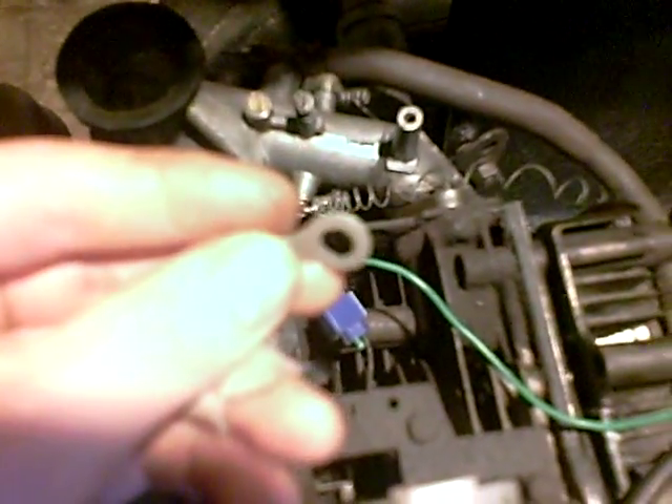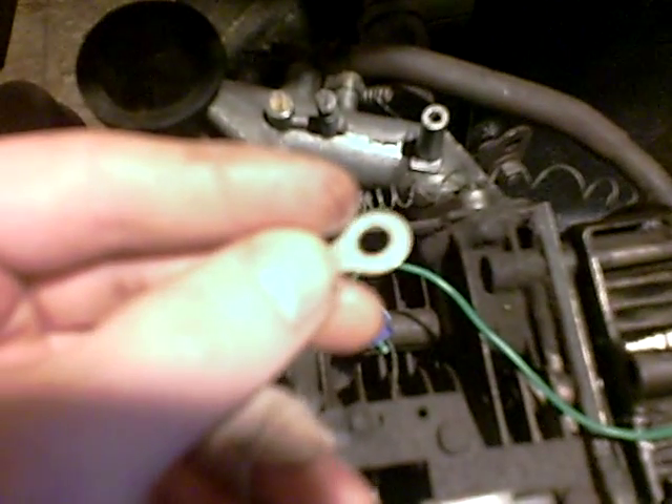I just put a little bolt in this thing — just a tight end of the bolt. I didn't really need it, but I put it there anyway just in case. And the gas pedal — it's just a standard bicycle thing. Now, my brakes didn't work anyway, so I figured I'd used the brake pedal. It wasn't being used anyway, so I just braced it right there to keep it from sliding back with a little piece of steel.